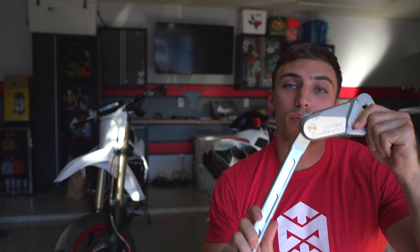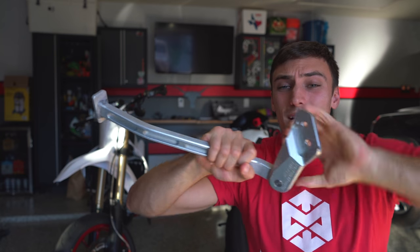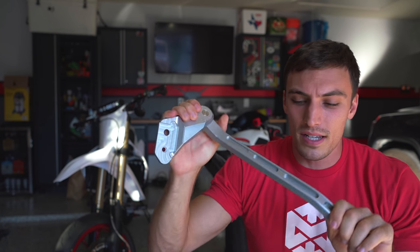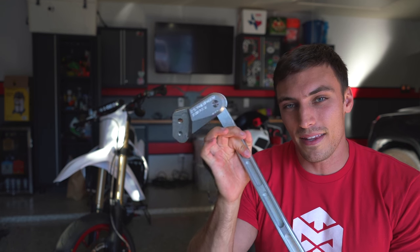So I wanted a kickstand and was just waiting on getting a good one in. This is the one I went with - it is the ProMoto Billet kickstand. What's cool about these is they're super high quality. All of the turning mechanisms are inside this unit. It's kind of hard to turn by hand but it's got a real nice snap to it, very very sturdy. What's cool is they offer cutting to a custom length, so if you've got something like a supermoto they'll cut your dirt bike kickstand to whatever length you want. Aside from the kickstand, I need to take care of the rear brakes - for some reason they lost pressure and the rear brake pedal isn't working as it should. And then from my meetup video when I rode the supermoto at the Texas meetup, I started getting some rub on the front fork guards. I cut them correctly so I don't know why it randomly started rubbing, but I just need to shave those off a little bit to create extra room so it doesn't rub on the tire.